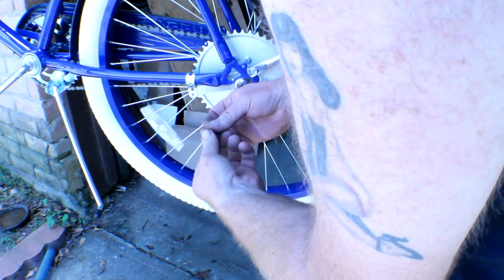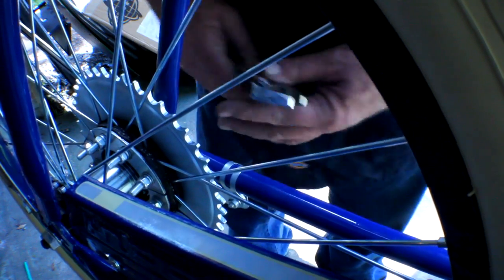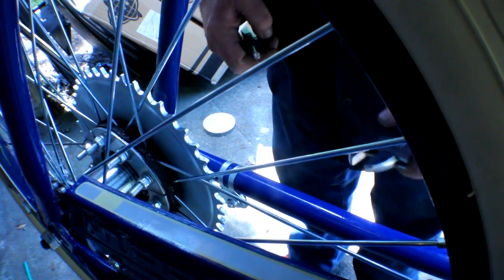Go ahead and put your screw in and put your nut behind it. Make sure that this nut doesn't rub or get too tight to the chain. If it's too close to the chain, you need to bring your brake arm out. I think we're good here — let's go ahead and tighten it up.